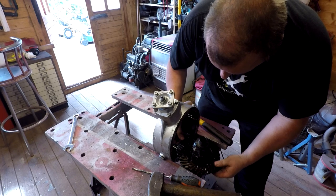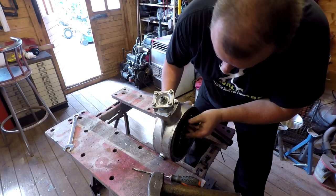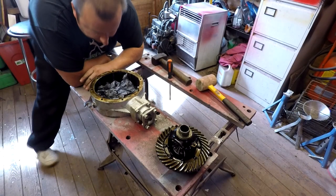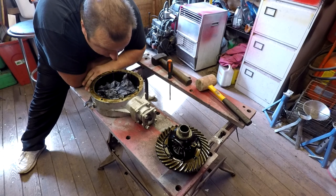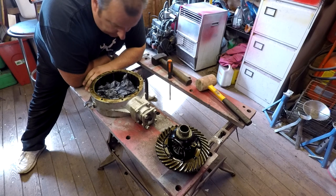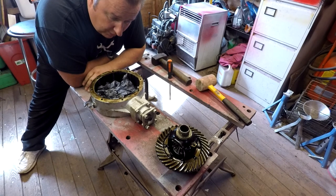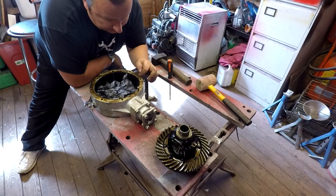This gives us a good chance to examine the pinion wheel while we're here, which literally floats up and down in there — so I can really examine the teeth. Basically there is no wear on them whatsoever, so it's a low-mileage vehicle. Whether or not it's been off before I don't know, but I'm sure these had a gasket on them from the factory. This one doesn't appear to have a gasket — it might have had some sort of mating fluid on it.